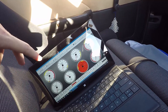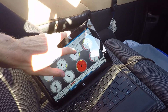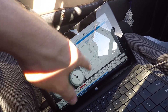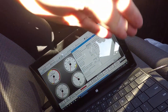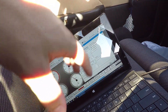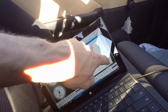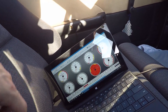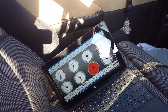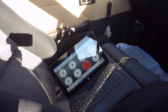The software's actually really easy to use. I just set up boost control — it's hitting 15 psi — and there's literally just a slider that controls basically how touchy the boost control is. You just get it to a point where it's oscillating, bouncing around, bring it back a bit and you've got boost control. Other ECUs can be real finicky on how they set that up. This is definitely an MS2 thing — MS1 didn't have this which made life quite hard. MS2 is so much better, everything's so much smoother with a lot more features. I highly recommend them, especially for a little 4AGE like this — they're super basic and these run them fine.